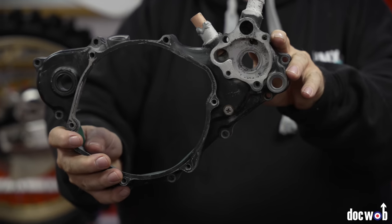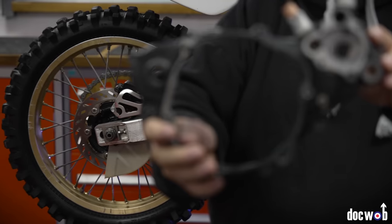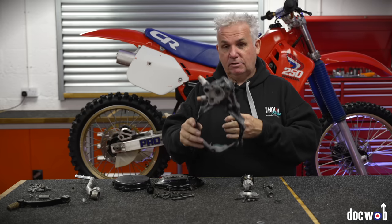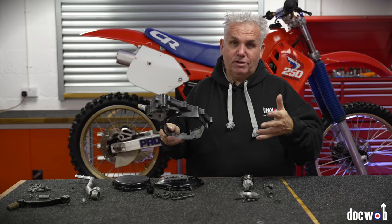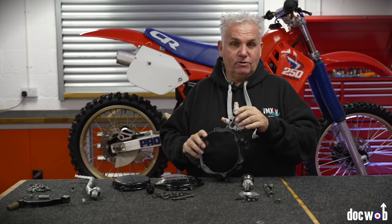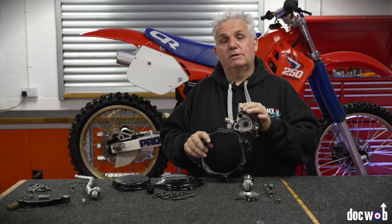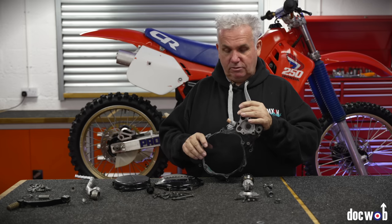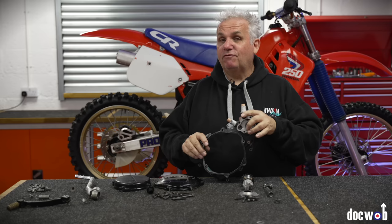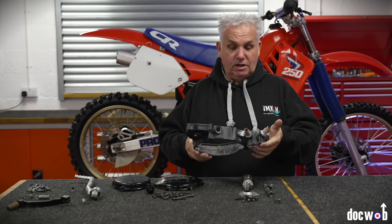This guy's inserted some copper pipe — it will work. The guy who sold me the bike told me it had a rotten water pump, so it's no surprise. When I dug it out it might have been repairable, until I saw you can see daylight through it. That's when the oil's milky. Now you can repair some of these with epoxy dye and whatever, but I won't. I did some homework — you can still buy these covers from Honda for about £210, but I found from China you can buy a replica one for like 45 quid. Got to be worth a try, so we've got one on the way.